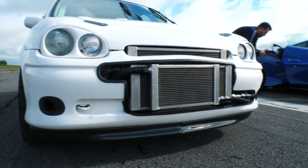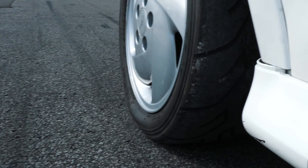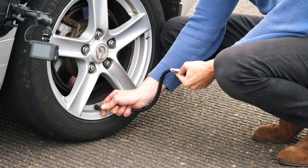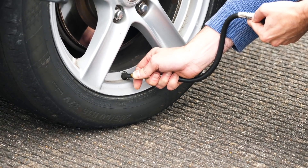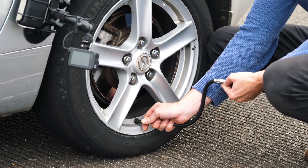Do you not remember Adam's Corsa with the really low profile tyres? I don't think it needs to be a massive dragster tyre with a massive sidewall — it seems like it would make a difference even on that, otherwise he wouldn't run low pressure. I can actually see the profile of the tyre changing now as we're bringing it down to 20. You'd never run this low pressure when you're on the road. We've got more weight going over the rear and more squatting happening when I do the initial launch.